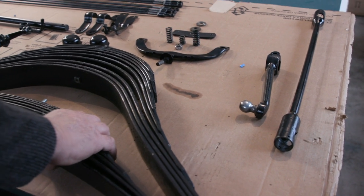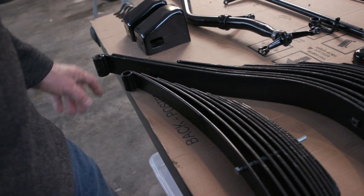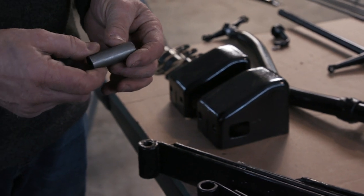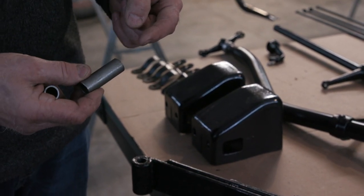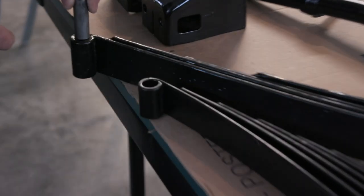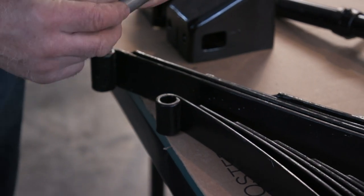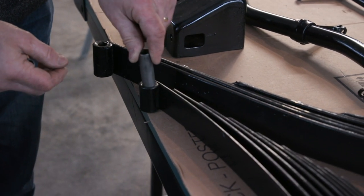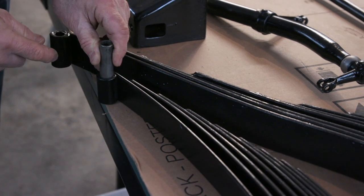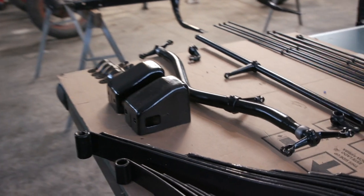The bushings are just steel bushings — they slide right in. There's a spot on the shackle that pushes grease in and lubricates it nicely. These are friction fit. For the front spring bushings, you taper them just a little and then use a press or a vise to drive them in. Pretty easy to do.